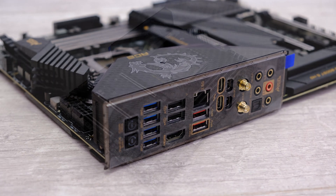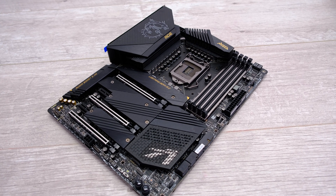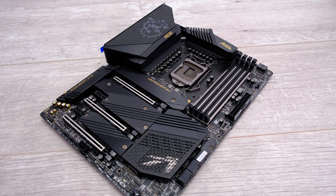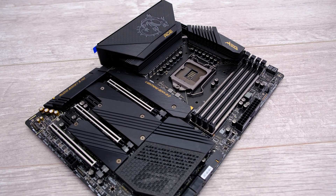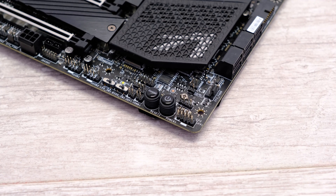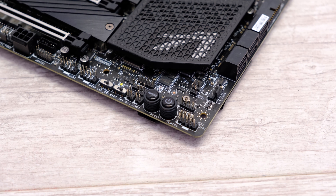That's a big part of why this motherboard costs so much. The CPU has a total of 16 power phases, and the VRMs were kept fairly cool with large heatsinks equipped with a heat pipe, keeping temperature below 54°C after a sustained test with the Core i9-11900K. The M.2 temperature peaks at 67°C with a PCIe 4.0 SSD, which is one of the higher results we've seen.